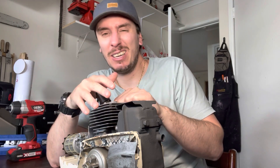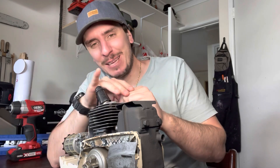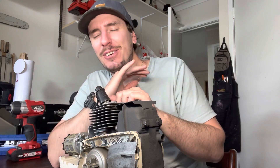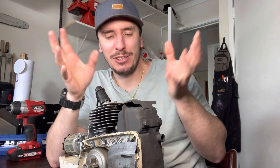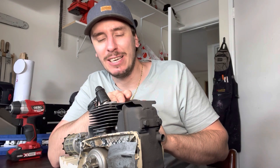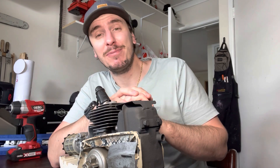This is the sound it was making before, so I'll show you two clips — about four seconds of the before, and then I've just gone out to the park now and started it up, so I'll do about four seconds after. Pleased to report, there is no pinging anymore. The normal two-stroke sound is a pingy-tingy noise, but you cannot mistake the two — they're totally different. The first clip is before I put the new top end in, and the old piston did have a lot of play between the skirt and the cylinder wall. This new one is perfect, so have a quick listen.